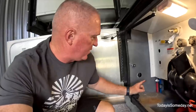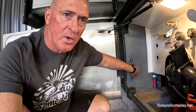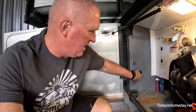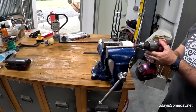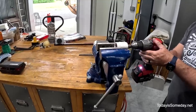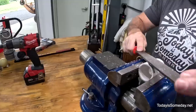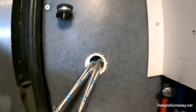Right now we're trying to come up with an option for the pass-through of the hoses from the storage bay into the wet bay, and trying to find something to keep the hoses from rubbing up on the rough edges here. I went to the hardware store earlier today but I could not find grommets big enough, so we're trying to come up with another solution. We found a piece of PVC, bored out in the middle so both hose fittings will fit through and the hose will fit in snug. We just need to smooth the top off so it'll fit through that hole and make a nice conduit for the hose to come through.